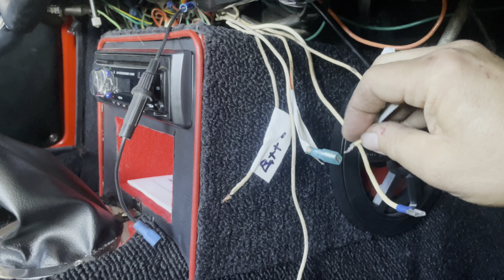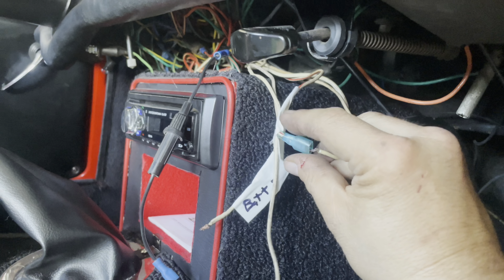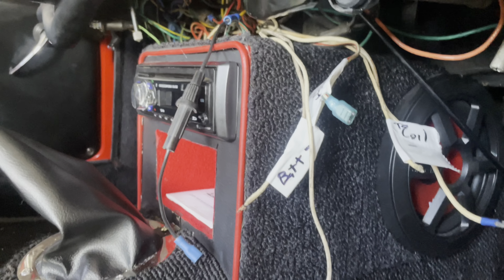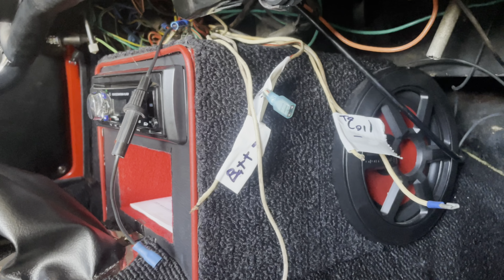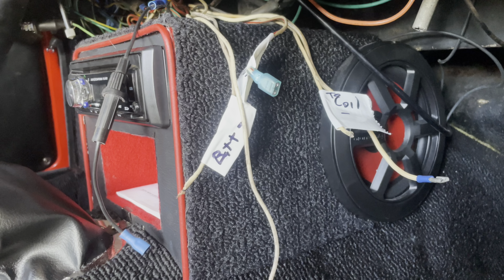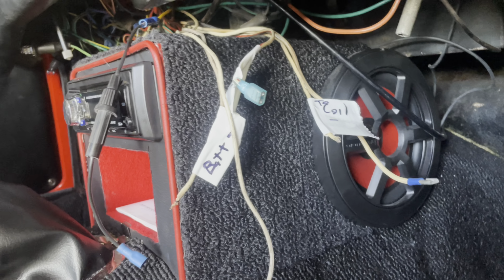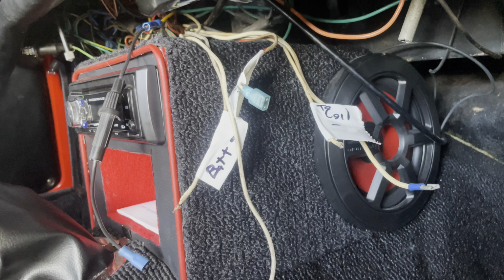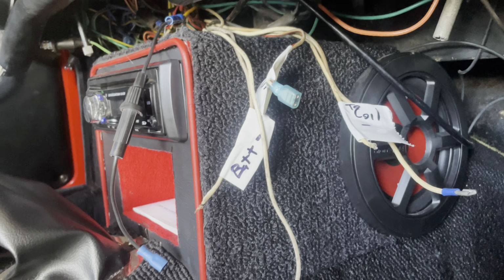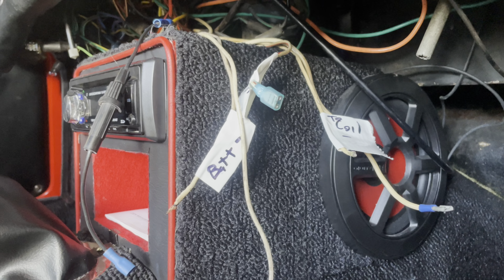This is supposedly our coil, but we still can't get her to trigger when we hook those all up. So, because I have intermittent continuity, and this thing does have the Crane kit on there for the ignition to make it electronic, I'm gonna chase its connectors up at its box and see. I got a feeling that thing's DOA.